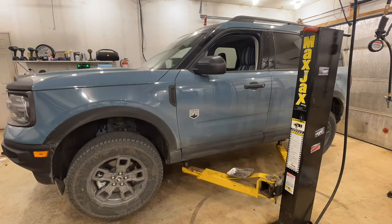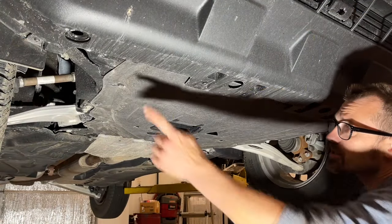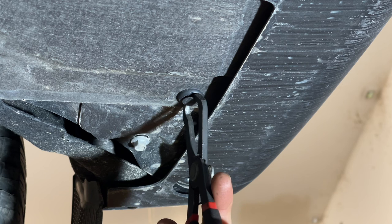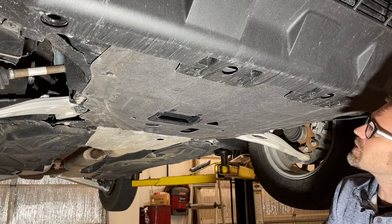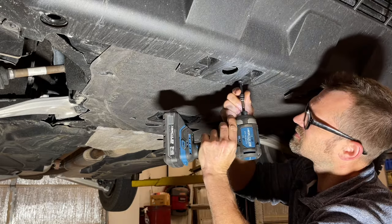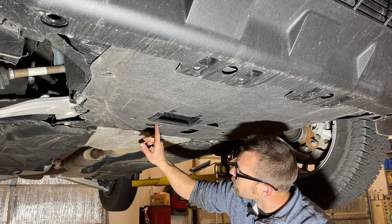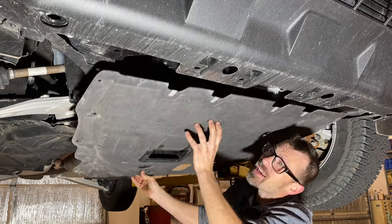Let's get this thing up in the air. The first thing I'm going to do under here is release the two plastic clips — there's one on either side in the front corners. We'll use our trim fastener tool for that. You just put this in the two slots, squeeze it, and pull it out. Then we'll grab our driver with the T30 bit and zip out all of these fasteners all the way around. Now that we've got all the fasteners out, there are a couple of points it's hooking on — one right in the back in the center — so if we pull it forward and to the side, we can unhook that and get the panel right out.